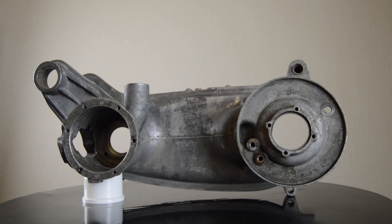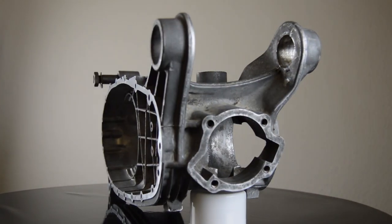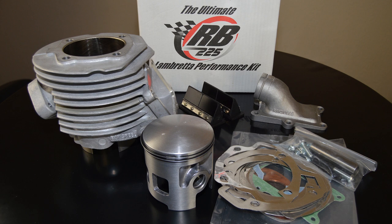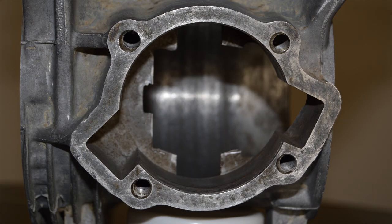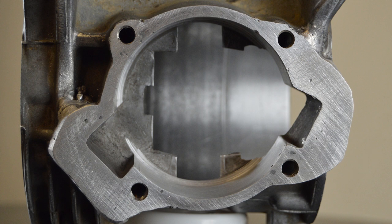After a lot of deliberation and comparisons made with full build prices for various engine configurations, I decided to go with AFRASpeed's latest go-faster kit, the RB225 setup. Now you'll all be thinking that's not going to fit your engine - you'll be right, but I've got a cunning plan. This would involve welding up the original cylinder stud holes and drilling and tapping new stud holes in a big block configuration.